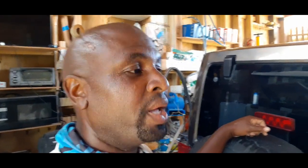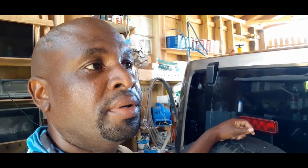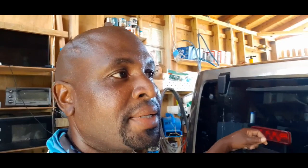The prep was done very well. The whole idea is to prep well. Sand, prime, paint. And usually people use a lot of wax on their cars. One step you gotta do before doing all that stuff is to de-wax the surface. And there's many different things you could use to remove wax. Acetone will remove wax. Lacquer thinner will remove wax. Awlgrip sells a special product called wax remover. And I use that most of the time on my surface to remove wax before you paint. But there's other product that would do the same thing. Soap and water is also good to wash your surface before painting.